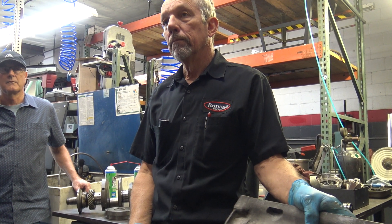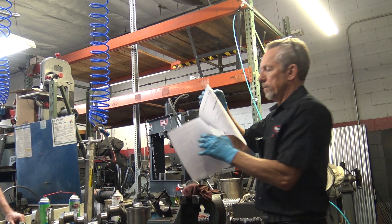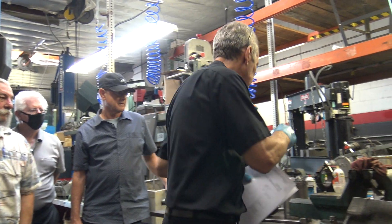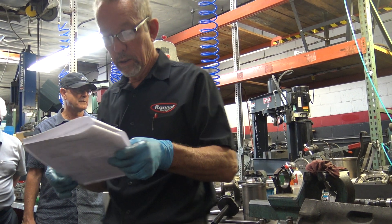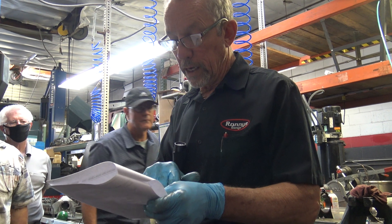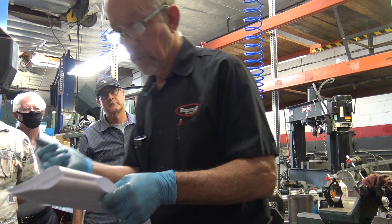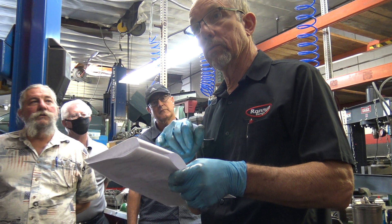What do you mean by grade? I'll explain it to you. If you grab one of those handouts, you can see that. So they have bores and pistons. The piston bore on a grade H — I think these are T's, they have a T or an S, it has both letters on it, which is not even listed on this old shop manual. A cylinder bore grading on H is 4.1 to 4.1003. The next grade is a J, and it's 4.1004 to 4.1007.